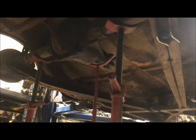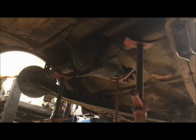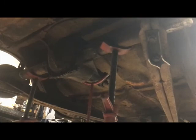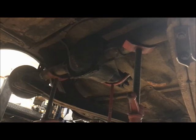And if I do, I have been doing some research with the Ford 8.8s and found that the 2006 and up Crown Vics with the super wide rear axle have 31 spline carriers. It is 31 spline axles. Nobody wants those axles. They're so wide, they don't fit anything. But I could narrow one down and throw Fox body axles in it, or just make it the width I want, which is the plan.